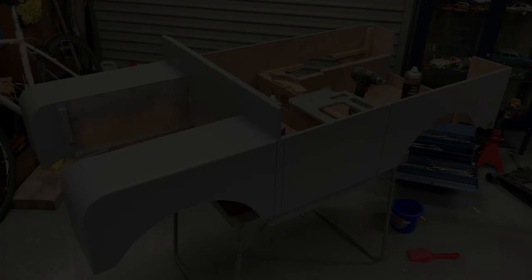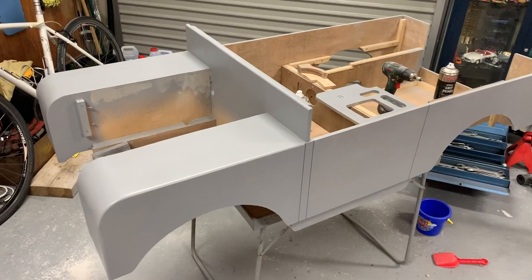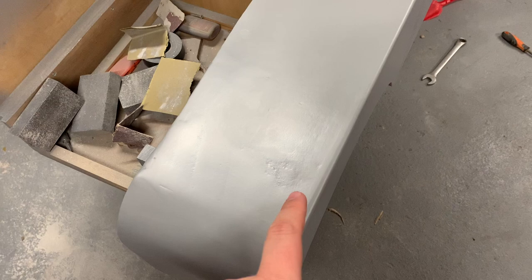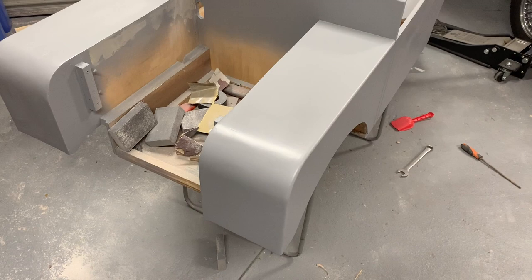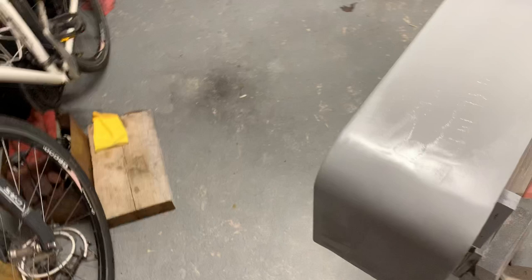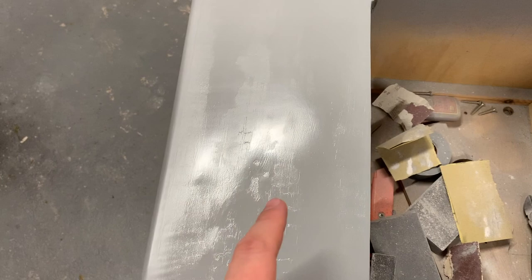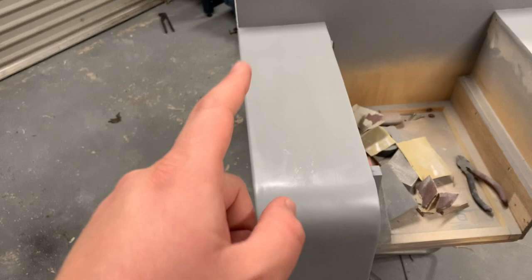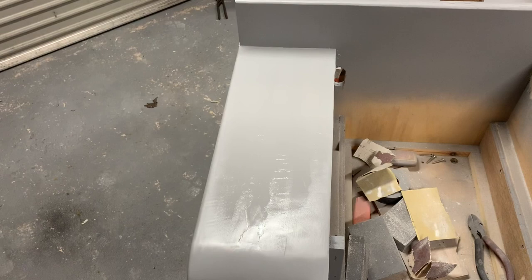Taking a closer look at the front wings — a little bit of wet paint still on this side, you can see it's a little more shiny, but I'm pretty happy with this wing. There are a few little marks and a small seam here, but I think I've reached the limit of my ability to get out any further lumps and bumps. Moving over to this wing, I don't really know why the paint's gone all funny and cracked like that — I may have put it on a bit thick. This side's still wet so I'll wait for that to dry before sanding it anymore. This side here has taken a significant amount of work: the filler went on without enough hardener, it went off too slowly — in fact it didn't go off at all — and I ended up scraping a lot of it off with a screwdriver, sanding it back and redoing it, which was very frustrating.